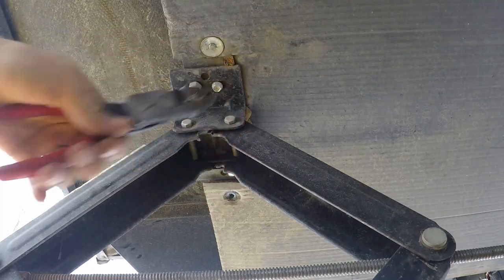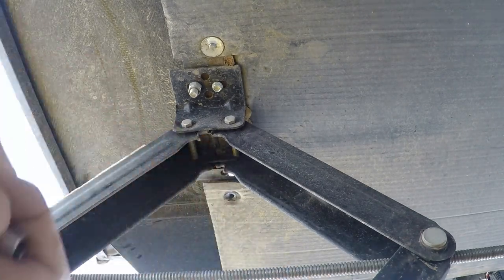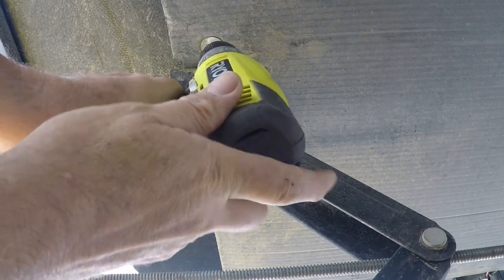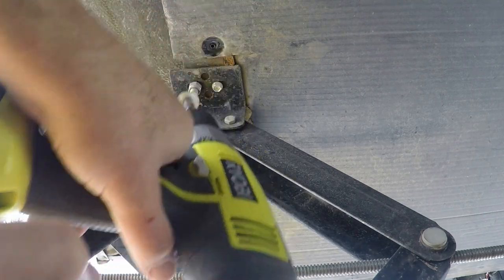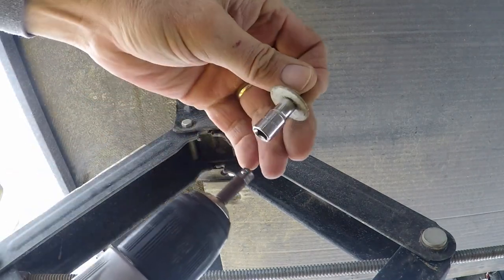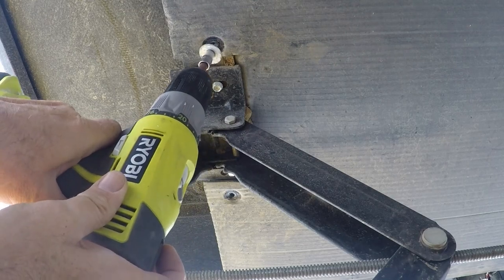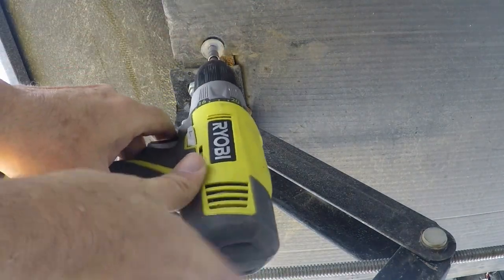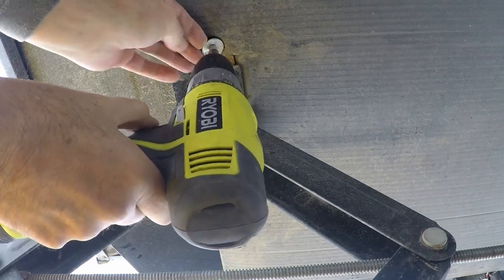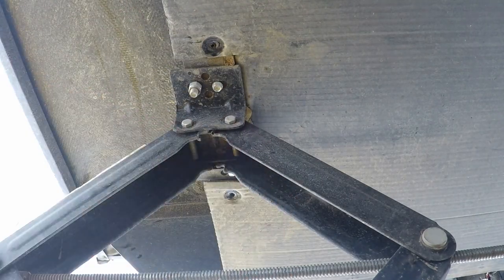The first thing I need to do is clean this plastic piece off of the head of the nail. Now let's try the quarter-inch socket first — put that on the drill, we're just going to reverse it out and see what happens. And there it is, just like that — it came right off, real nice and easy. A little stuck in the bit, but here's a trick to get that out: go back in the hole a little bit and just go back and forth. That one came out without breaking.